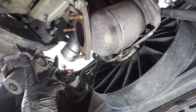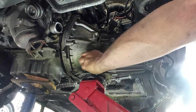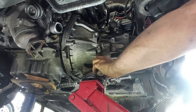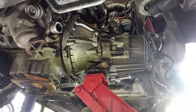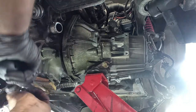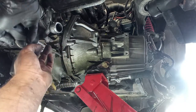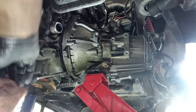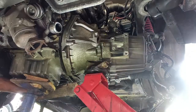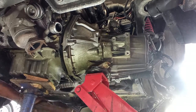We are dealing here with a lot of weight and it is very delicate, this operation. So let's try it with a jack, trying to balance the gearbox. Let's try here. Then lever it out, but be careful not to damage this part over here. This one is completely gone. The half shaft over there can be a problem. Yes, it can, but let's deal with that in the process. This shaft does not have any ring.